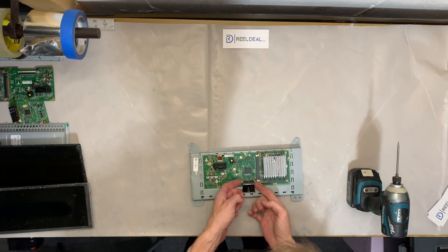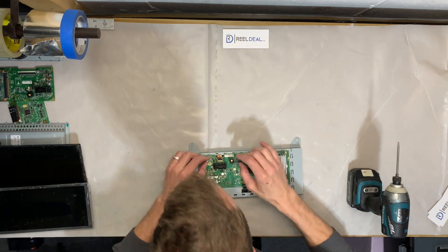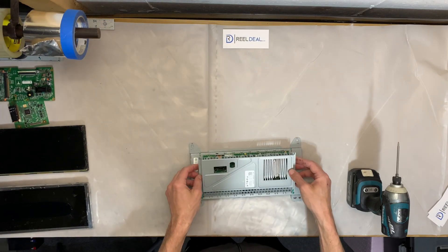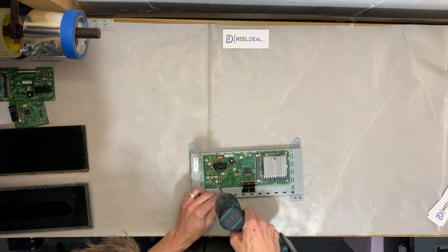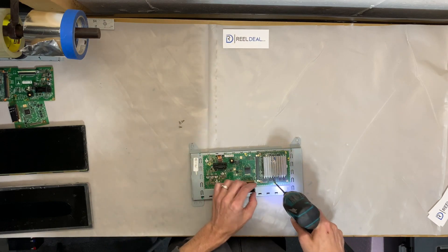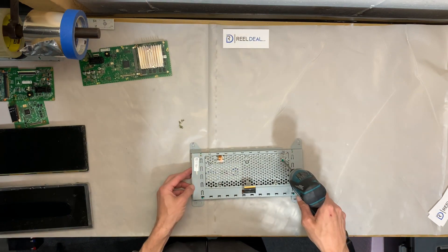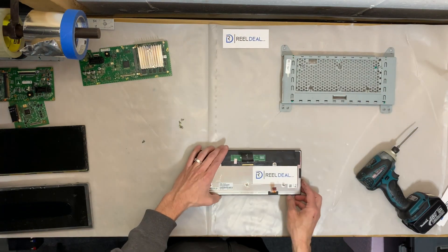Now we're going to go inside and I'm going to show you how to remove the ribbon cable. That white piece of plastic there will not come out on yours — mine's broken. You just lift up on that and pull the ribbon cable out, and then there's another black one for the other ribbon cable. Just lift that tab up and the ribbon cable comes right out. Now you're going to remove these T10 screws — there are quite a few of them, I think probably eight. There's one tricky one that stays underneath that ribbon cable, and after that you can pull the driver board right out. There's only one screw that actually holds the instrument cluster to the housing itself, and after you have that removed your cluster is out.